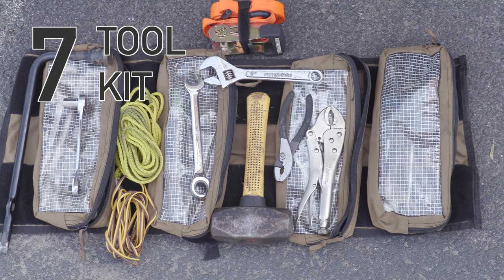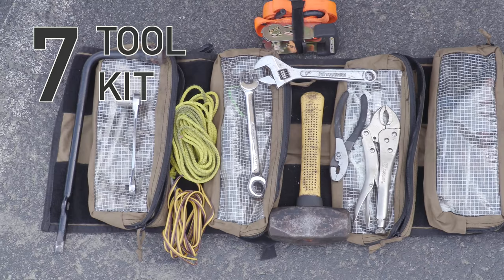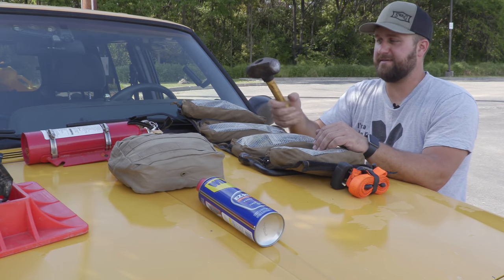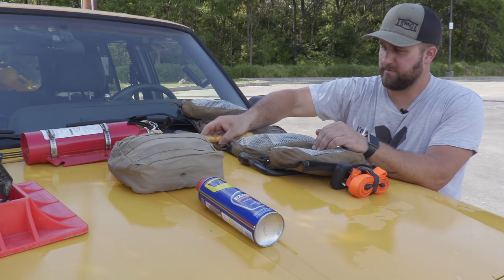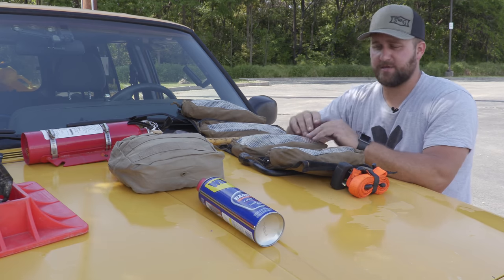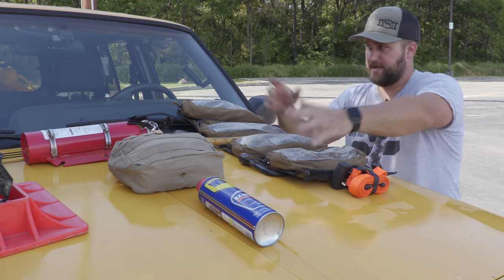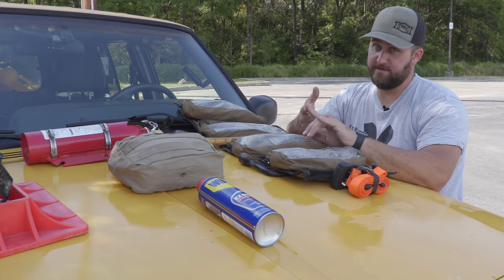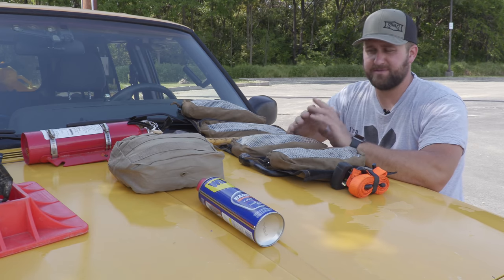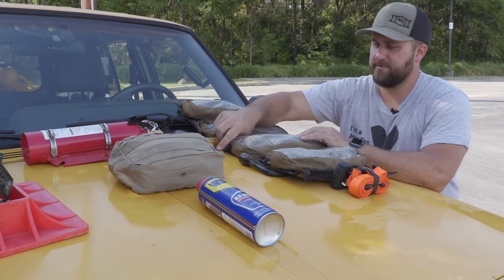This is a kit I've been building over the years. Let me talk about the top things to have in a toolkit. A mini sledge — or BFH — is very useful if you have a rollover, bend a body panel, something's cutting into your tire, or you need to straighten a tie rod. I'm not going to open this compartment; it's all sockets and ratchets. On most Jeeps, the common sockets are going to be 10, 13, 15, 17, 18mm, and in standard 7/16" up to 3/4" is the minimum set of wrenches and sockets you want.